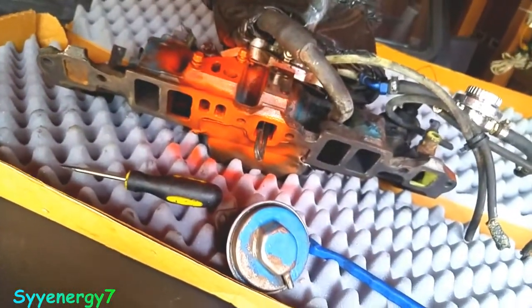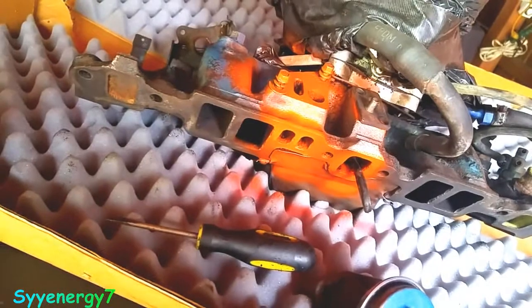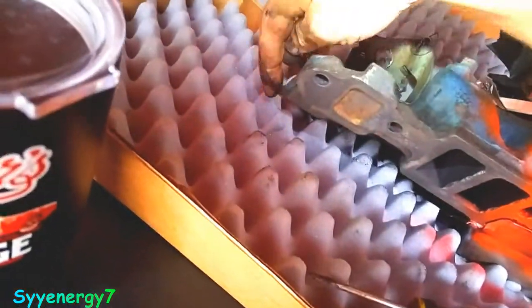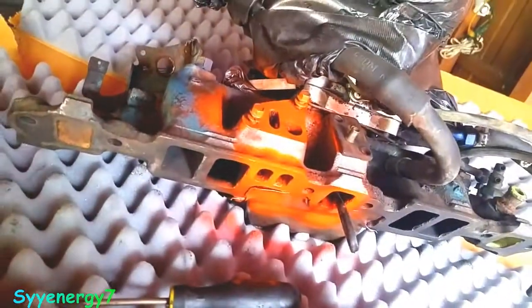So if you take that to a mechanic, they're going to charge you a couple bucks for that garbage, man. You know what I mean? Unless they take the manifold off and boil it or something. Maybe that's what they would do. But that'll cost you some money too. So either way, more than likely, it's all labor except for buying new gaskets. And even with these gaskets, you put the RTV on, you make an RTV for the front and back. The gaskets usually aren't that much money for the intake manifold. You can usually reuse the gaskets, or you could put high temperature RTV on there, which will work too.